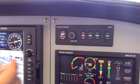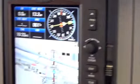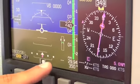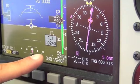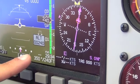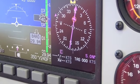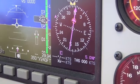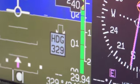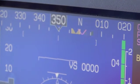We also have a value button here. Push it in and on both screens you have a heading displayed — it stays up for about five seconds. Click it again and it goes to altitude, always set to our current altitude. Click it again for baro — the altimeter setting — which we can also adjust on the Dynon. You can adjust it and you can see the heading bug on the heading tape change to whatever heading we want.